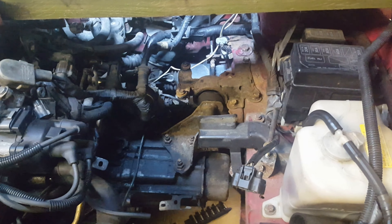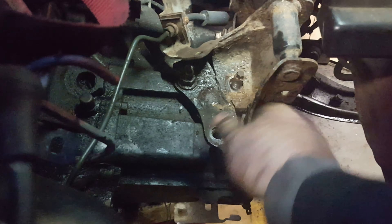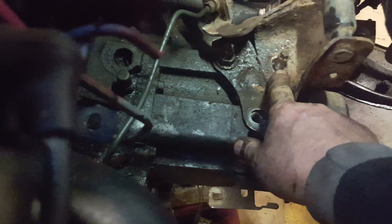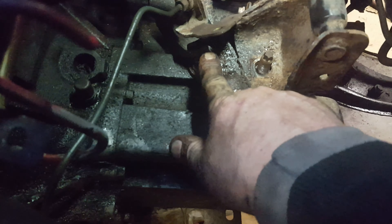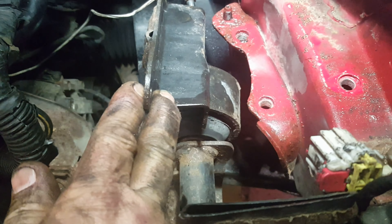The next thing is to remove a couple of the engine mounts from the transmission. The first one is this guy here. I'm going to be taking this mount all the way off. I've got the other one off. The whole thing is supported by that 4x4 on the fenders and we should be good. I'll bring you back when that's out and it's ready to lower.